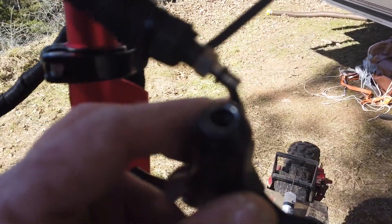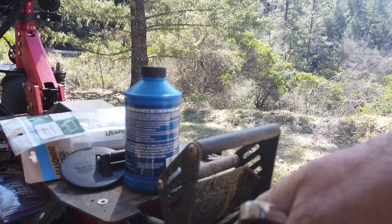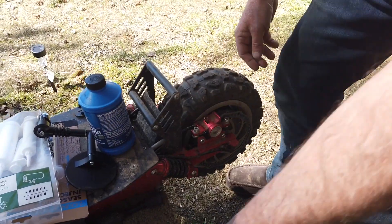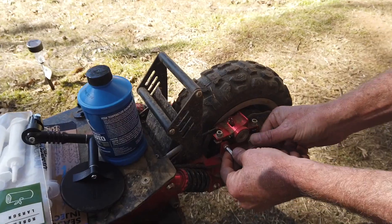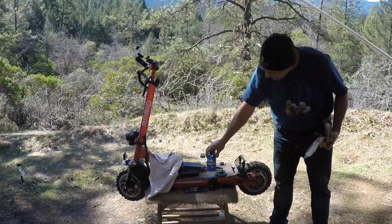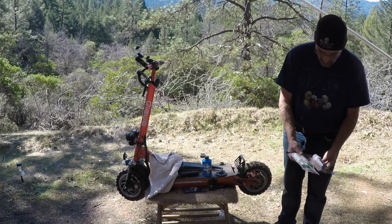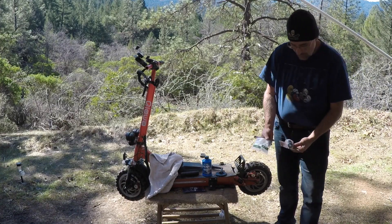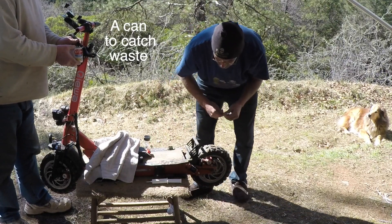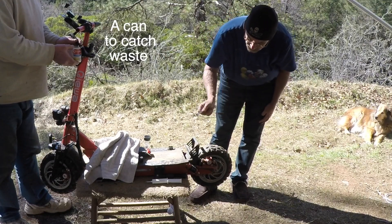Loosen off the handle — I can see there's some fluid in the reservoir but not enough. The rear hose connects to the brakes here and I think we have to remove the entire brake unit. To get the fluid up the lines I have a series of syringes to make sure there's no air in the line. Now I'm going to disconnect the rear cable and inject quite a lot of fluid in just to make sure there's no air bubbles.